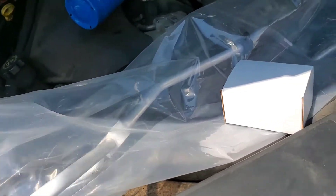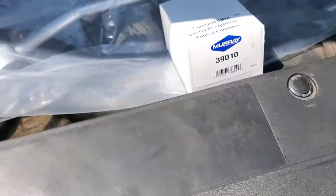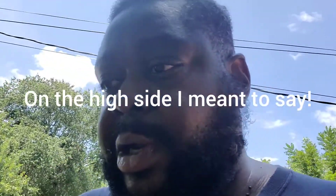I also picked up an expansion valve. This truck has rear air and the rear air didn't work. Watching a YouTube video, the guy said if you hook your gauges up and experience really awkward pressures, there's a possibility your expansion valve is clogged. The expansion valve is like an orifice tube for the rear AC — both of them catch trash. I bought the new tube and the expansion valve, though I might not do the expansion valve today since it keeps raining and I'm tired.